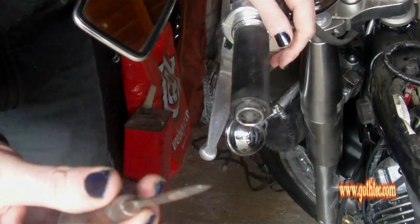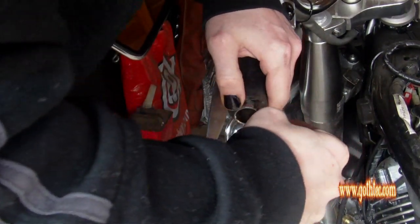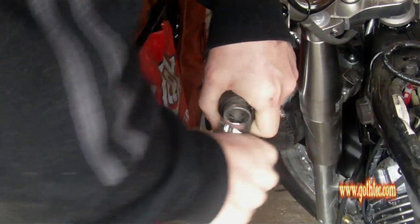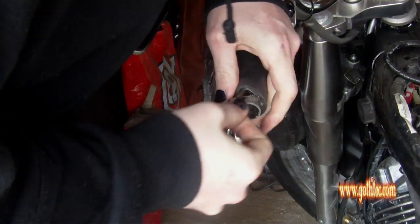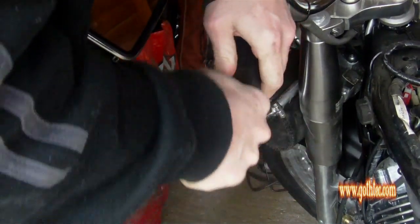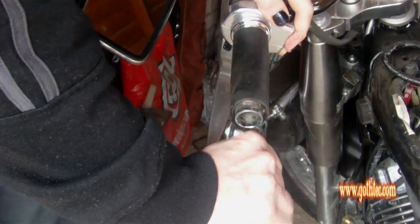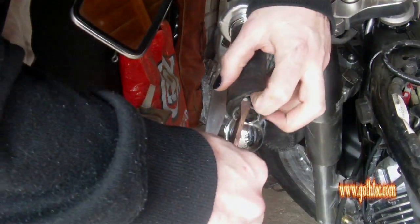Just take a flat-headed screwdriver, the longer the better, and just basically ease the glue and the rubber apart, and it just goes straight round, and so you're not cutting the grip. Now that's already freed up that much of the grip. There's still that much to do, so you take a longer screwdriver. Right, I've got a longer flat-headed screwdriver, it's a little wider, and just press it up underneath, work your way in and work your way round.